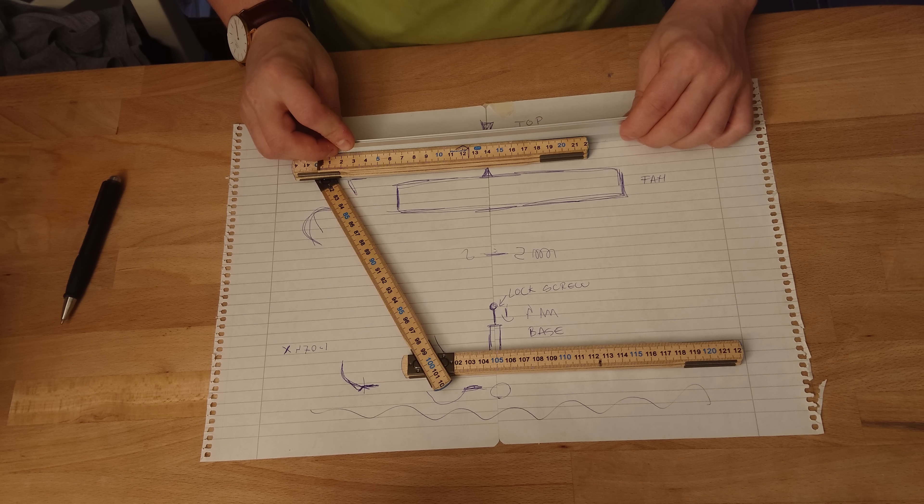If you push it this way, especially for those three millimeters, it's not going to be such a big impact on the pipes because they've already been bent and stress-tested a little. When you're doing this you're not putting so much pressure on the pipes. Don't use much force — just one finger here, one finger here, and push slowly. You can also do it while it's already screwed into the motherboard if you have enough room. That's how I did it.